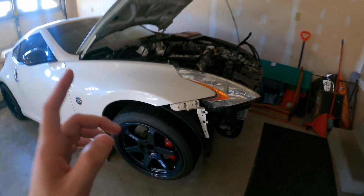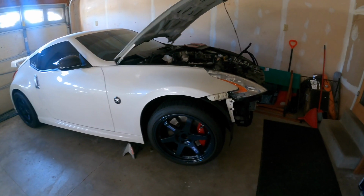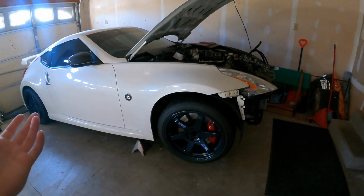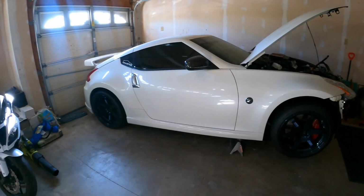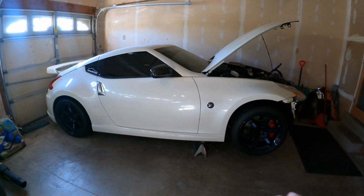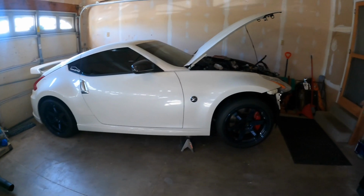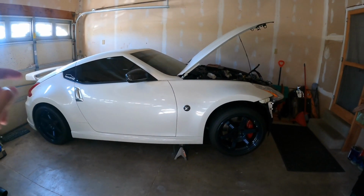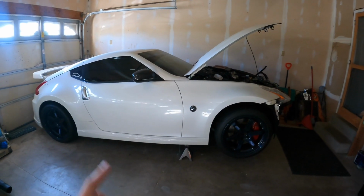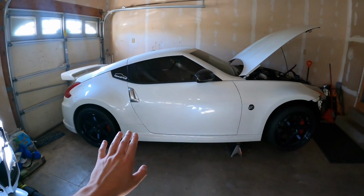If you're thinking about boosting your car and you haven't had a turbo or supercharged setup on it previously, I also did a video prior on how much it costs to turbo a VQ. Z or G, they're gonna cost the same. If you're just looking for a stock platform where you're gonna make between 500 and 700 horsepower, you can do that on a VHR or stock bottom end. The trick is just keeping the torque low. I'll leave a link in the description to the video about how much it costs to simply boost it with no motor work.